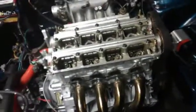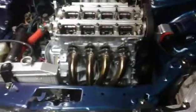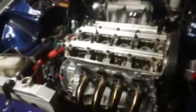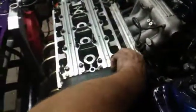Tomorrow I just have to set the overhead, get the header back on, coolant lines, fuel injector harness, and all the other little bells and whistles — then this thing will be running. Stay tuned to see what it does. I'll probably have to adjust some fuel maps since we went with a larger cam. Eventually I was going to take it up to Mark Edens and have him tune it, but it's just temporary for now.